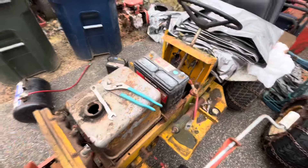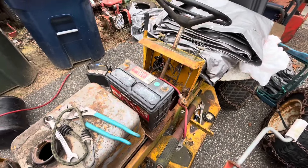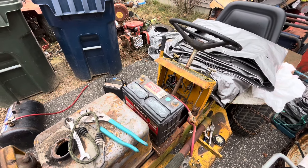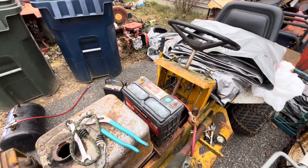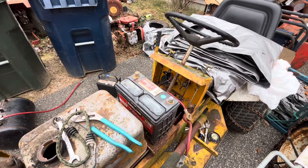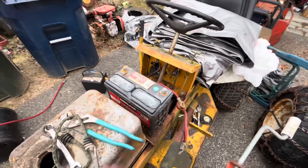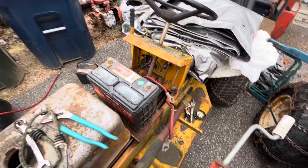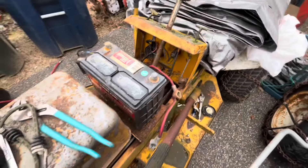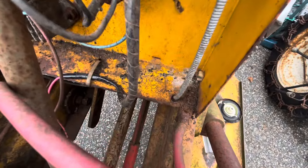Got the hood off the 430 and unhooked the old Costco battery. That thing has been in there since 2014 — two years ago it still worked, so it lasted a long time. But it's totally the wrong size — a little too fat — so it makes it hard to jump if you need to because the terminals are too far to the edge. And the connections here are horrible; there's so much rust where it goes on the frame.